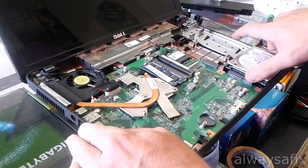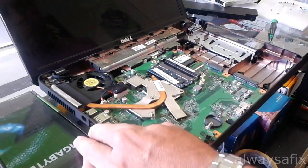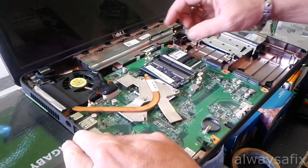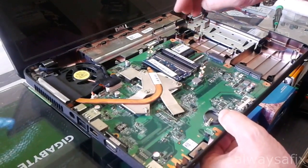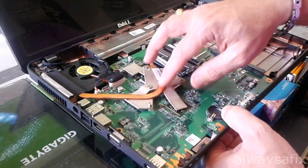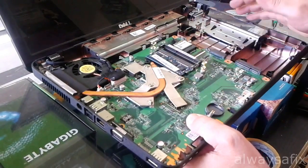I've already done this one so it should be easy. That's where you find the hard drive — unplug the hard drive. There are two screws on this motherboard: one, two. And you need to disconnect the cooler, the heatsink from the motherboard as well — four screws here.